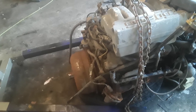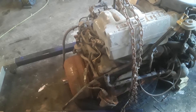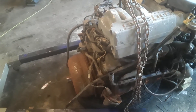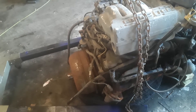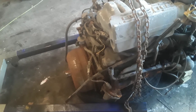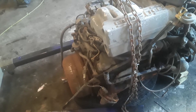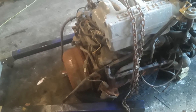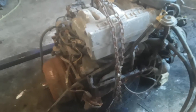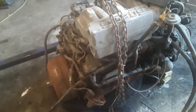That's really why I got this motor — we're going to go Holley. The Holley system is cheaper than blow-through and there's really no arguing on it. A simple blow-through setup is only going to support so much, and before long I'd have to upgrade to the MSD grid to control ignition timing, boost control timing, all that stuff. By the time I spend all that money, I'm going to be as close to the same as an EFI system anyway. The Holley Terminator system for these motors is around $1,100.